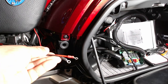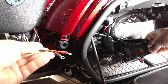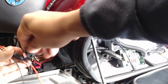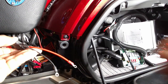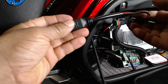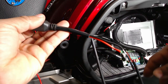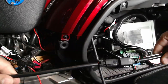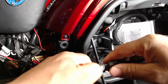How I plan to hook up my Corbin seat, I'm going to be taking the ring terminals on the 7.5 fuse and connecting up to my isolation fuse block on the 10-amp side. Keep in mind the Corbin seat has that 7.5 fuse inline, so I can't pull more than 7.5 amps without blowing the fuse. I'm going to hook up a quick connect so I can always disconnect the seat heater without having to cut the wires. I'll hook up one end to the key switch and it plugs in like so — that's my power. If I want to remove the seat, all I have to do is unplug it.